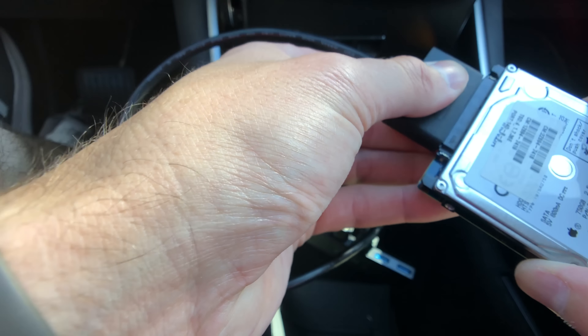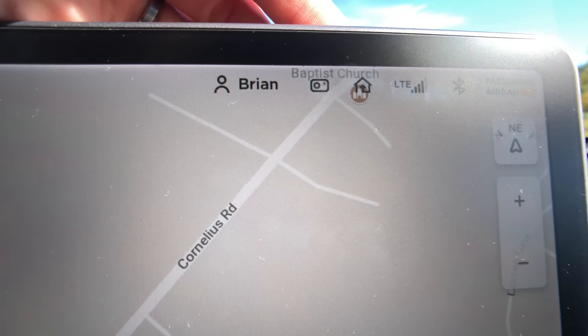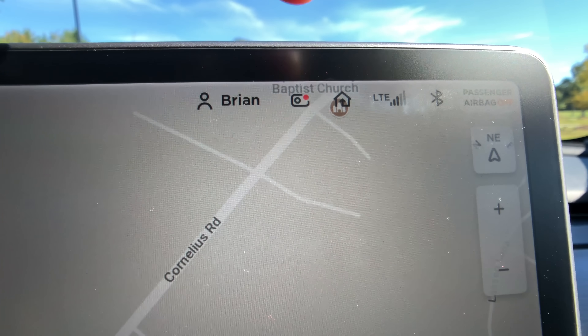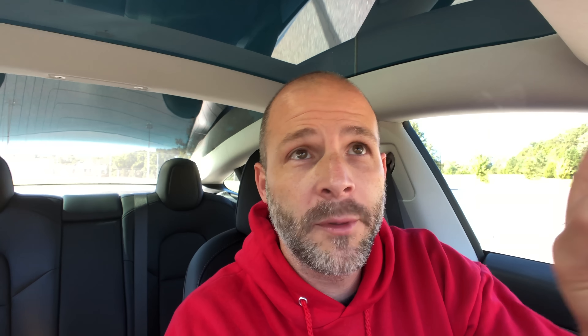You remove the hard drive and then plug in the other hard drive. I can hear it spinning — I can feel it spinning. The USB has enough power to spin this, and we're going to set it down carefully in there because that is a moving, spinning hard drive. Since we paused it, it still shows the dash cam up there. Just tap it — you don't have to hold down for 3 seconds — and now the red light is on. So we have a spinning hard drive now recording from the dash cam.